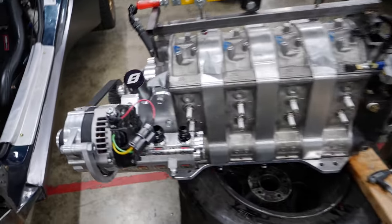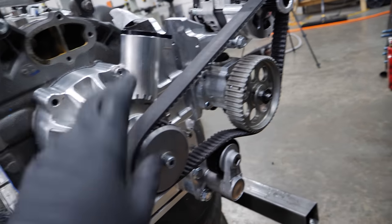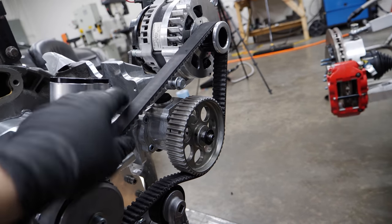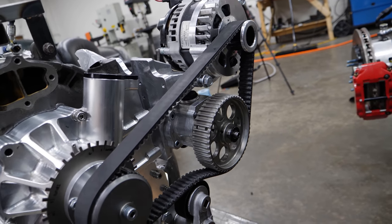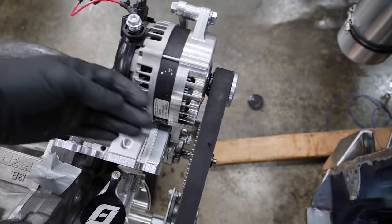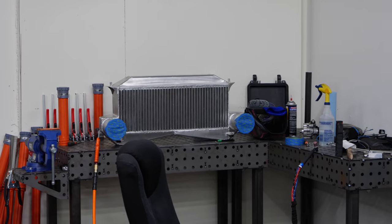Got the oil pan back on. More importantly, I got my little tensioner on as well — I built that out myself. It's not so much to put tension on the belt; I don't want to wear out the front roller bearing or the ball bearing that's now in the front cover. This isn't putting pressure on it as much as just taking that little bit of slop out. The dream situation is that the alternator would just roll out that way, but given the chassis, that's not going to happen. Everything is super, super square, so it wouldn't even want to fall off anymore. I'm going to take this off one more time to drill the heim joint for the correct steering. He's getting the rest of that done and just cleaned up the intercooler, about to weld it back together.